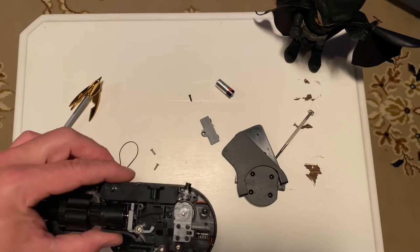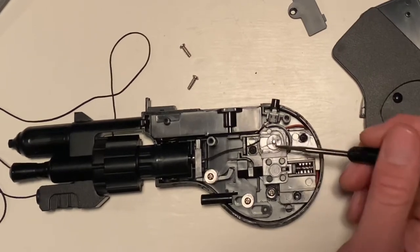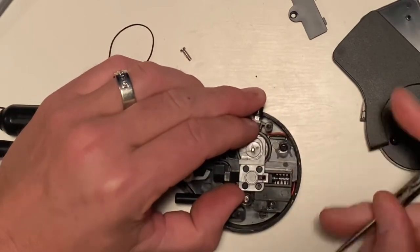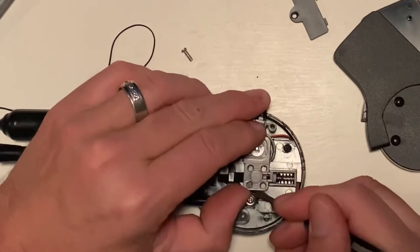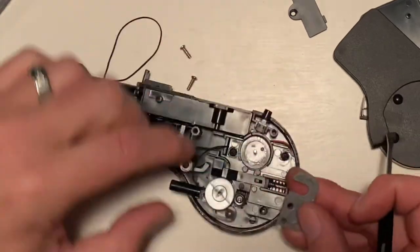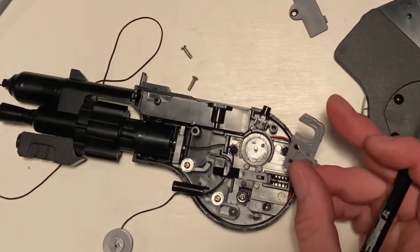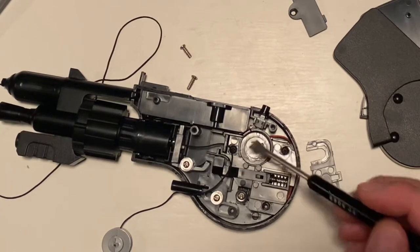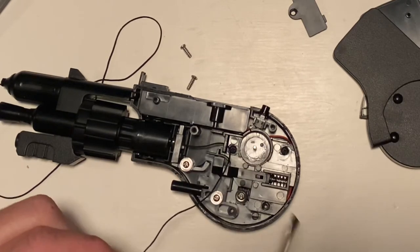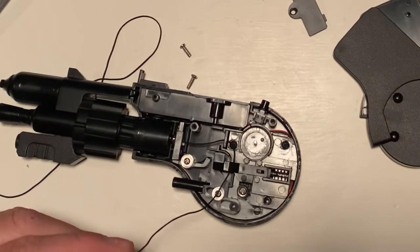The one main issue I had with this was getting it open without destroying it, and I was quite lucky. I'm going to go through and show you some of the components. Basically you've got this gray plate that goes over the spool as well as the motor pin. You can pull that off and the spool will pop out — it sits loosely inside there — and that's to avoid the string from getting broken; there's a fail-safe in there. You have to be very careful when removing this that the motor pin does not come dislodged.